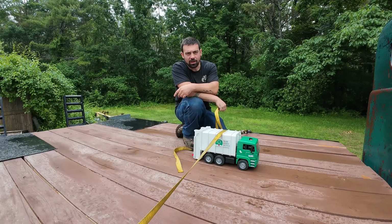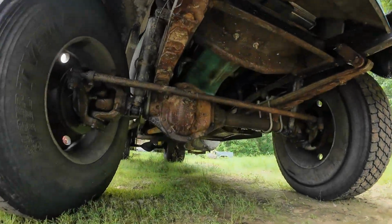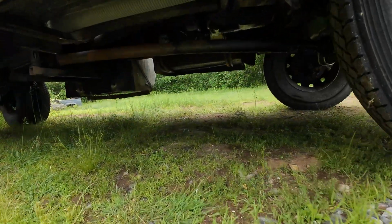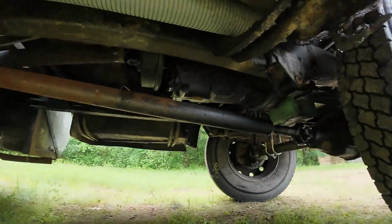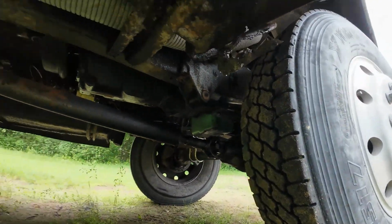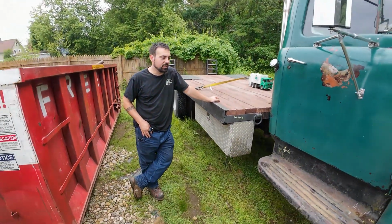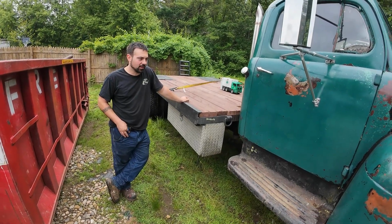Made all my own custom drive shafts. It's the longest eBay build-your-own drive shaft you can get. It's meant to be cut down to length. I didn't cut it. I put the transfer case wherever it lined up with the longest. Holy crap! And then I had to figure out how to buy and assemble a whole two-piece carrier bearing in the back. And figure out where all the slip joints needed to be, and it hasn't exploded yet.